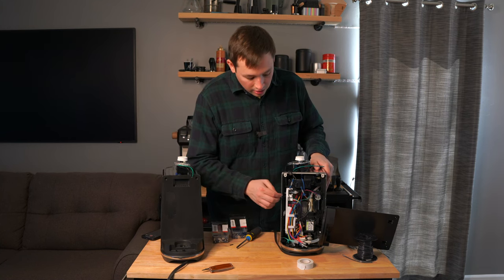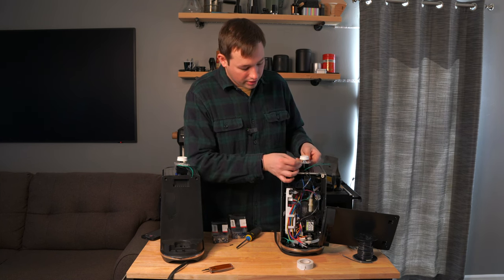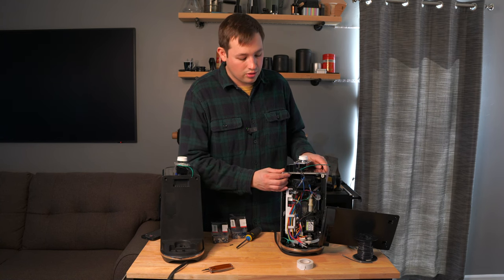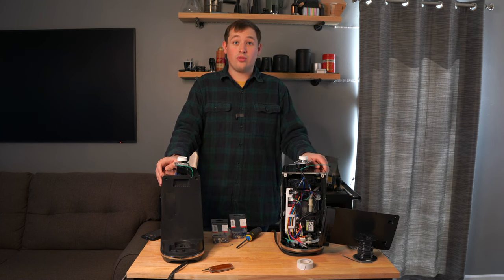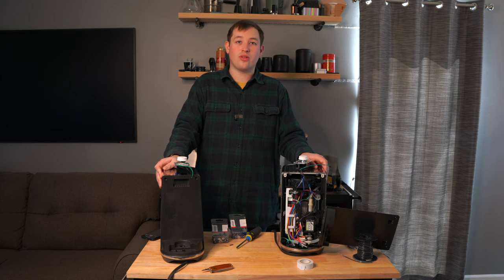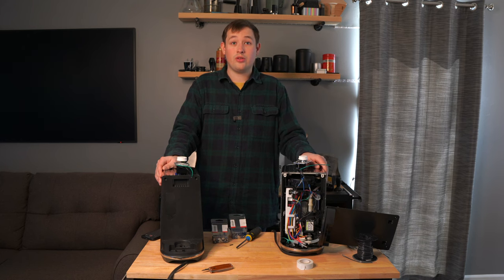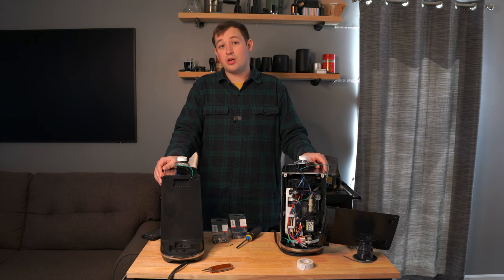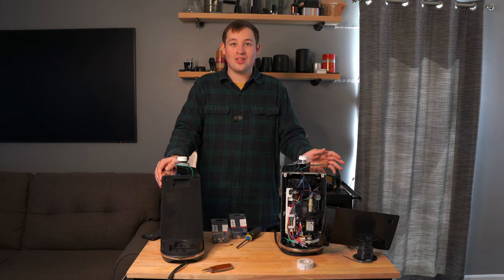On the Bambino Plus, there's not really any plastic getting in the way, so you can set everything flush and put the back on with no issues. That's how you do the dimmer mod and flow control mod. The reason you'd want this is it allows you to get good espresso shots even if you mess up your grind setting — you can adjust flow rate to hit that 25 to 30 second extraction window. If you have questions, drop them in the comments. Don't be intimidated — it's easier than you think, and I have zero electrical background. Thanks for watching!